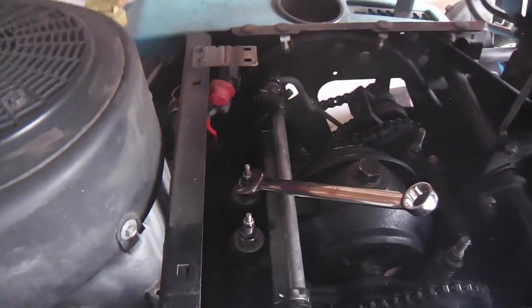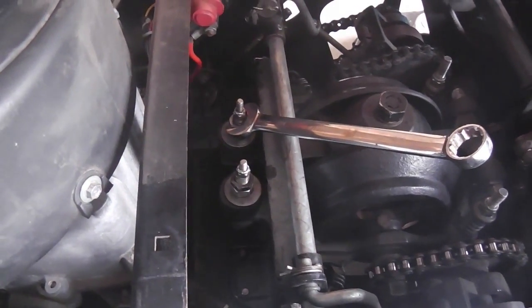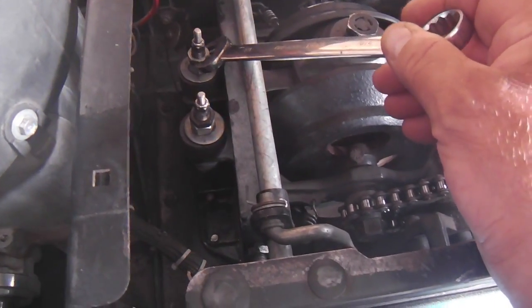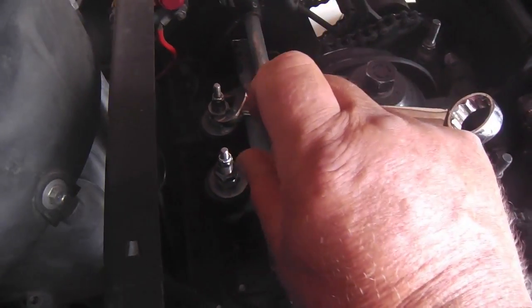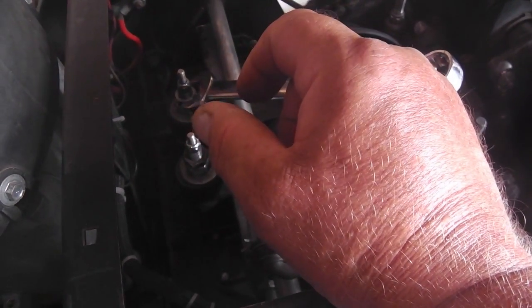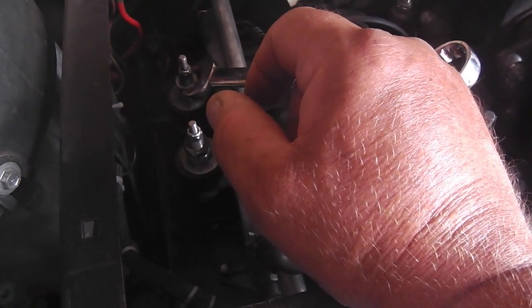Okay, so the final adjustment, very subtle, after mowing on a couple of properties. I focus more on the left side, of course, because that's the stronger, faster side. I dumbed it down a little. First, I broke loose these two jam nuts, and then also clamped on down below with some small vice grips so I could not only release some tension from the top threads, but down below also, so I could release the preload from on top and below. It's a minor point, but there was probably a full 3/4 of a turn if I added those two actions up.